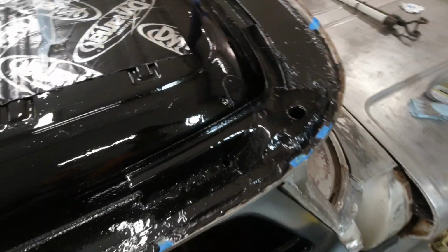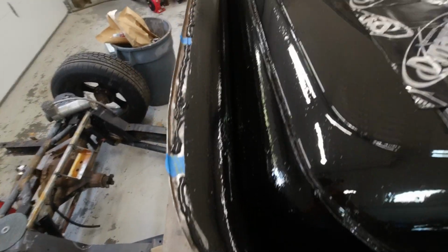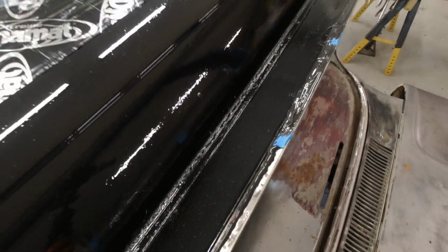It's pushing out the moisture and the oxygen from directly against that connection, so it should last for a longer time. Part of clamping is not just clamping it for structure and so that it can cure in the tight position, but it's also to push the oxygen out from in between there, push the air pockets out so that this gets good and sealed all the way around and you don't have to worry about this thing rotting later on.